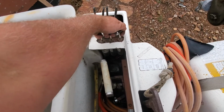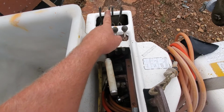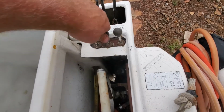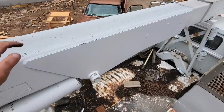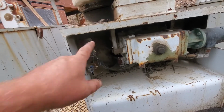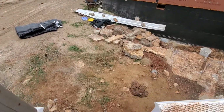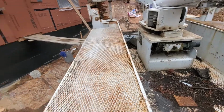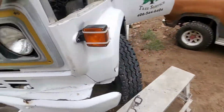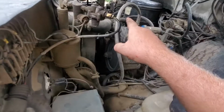We were able to figure out that these are, we don't quite know the order yet, start, stop, ignition on, maybe. We're not sure. They're actually air switches. You pump them up, and they pass through the boom down into here. These 3 air switches right down here, we were able to figure out that they have power when the ignition is on. So the ignition actually passes through here. There are problems with them. They don't seem to be working. What it seems to be is that those switches are essentially jammed on, whether by design or by fault, not sure yet. And they pass into this big box right here, which is full of massive starter relays, and that then drives the actual ignition system and the actual starting system.